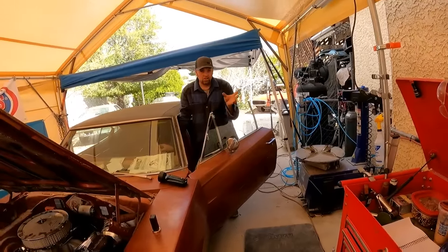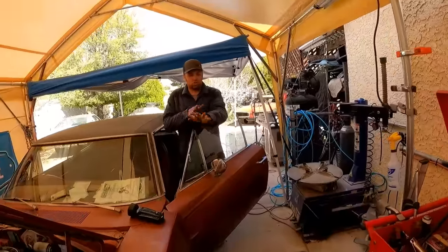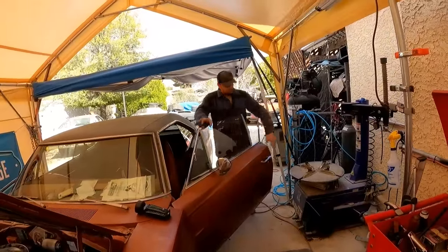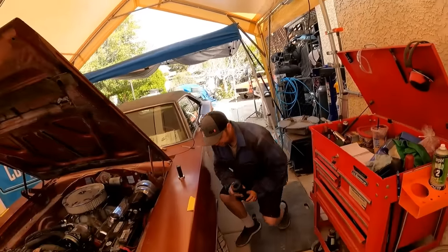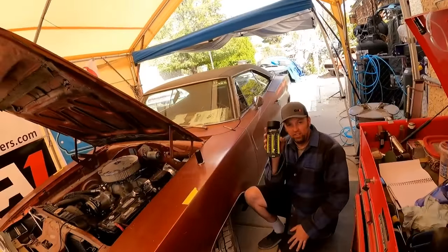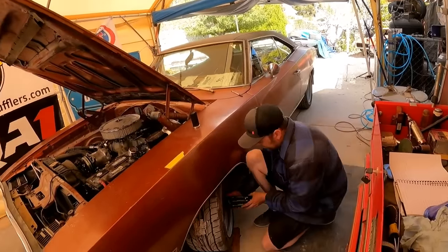Like racing go-karts, shoot, those things are like 15 degrees of caster, man. You turn the steering wheel, you're actually seeing the whole chassis flex. You know, we don't need that much on these things. But this guy here is cool. I had to school the Dulcich and the Freiberger on the caster camber gauge.